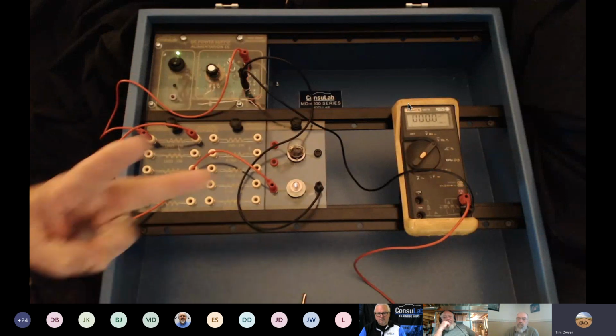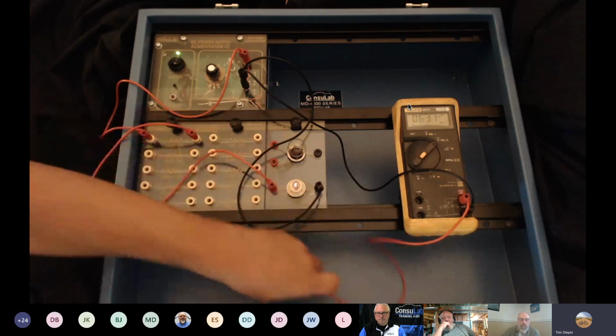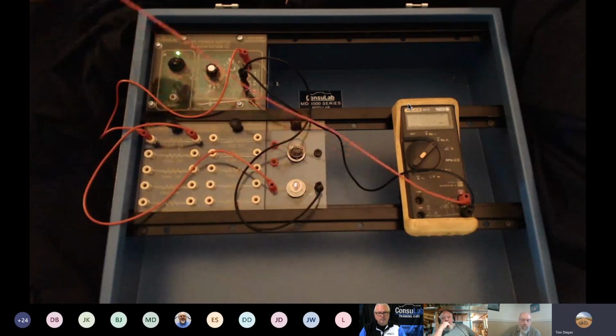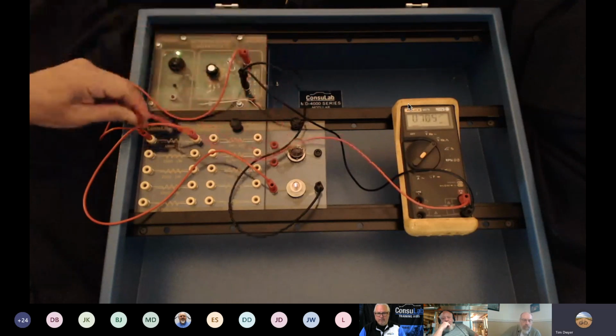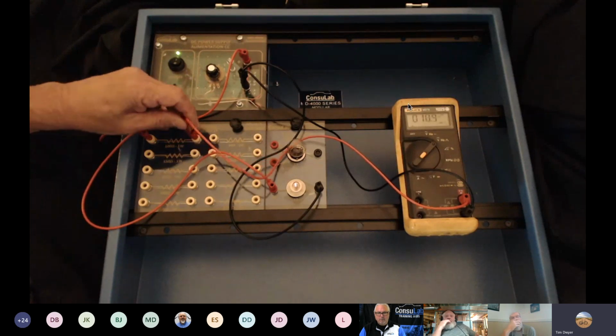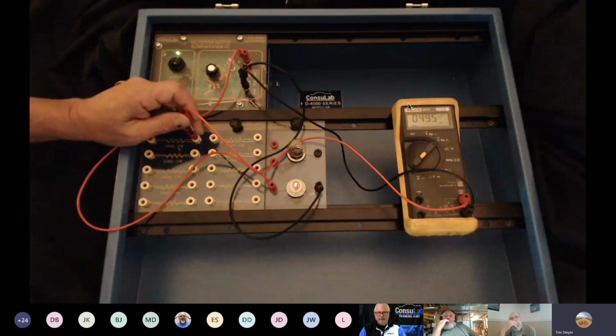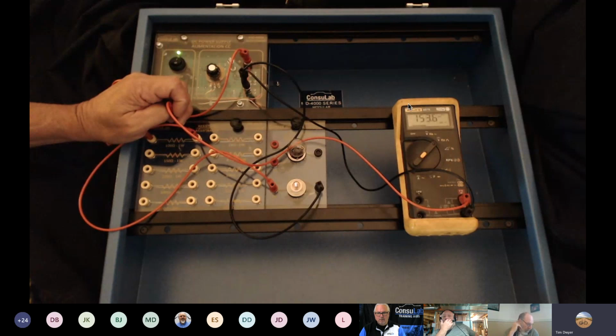So in essence, there's two loads in the battery. Yes. And the expectation as a student or a teacher is it leaves the battery full charge. He arrives at that first block in the circuit, the first resistance in the circuit, full charge. But to get through that resistance, because what do we expect? I used to joke with my students, I want to see a tattoo on your arm for voltage drop, and the definition is the loss of voltage by passing current through resistance. And if you don't have all three, you don't have a voltage drop.